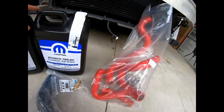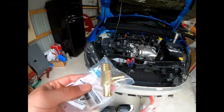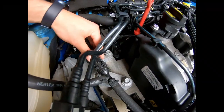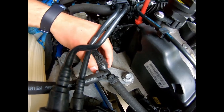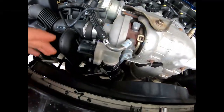For some of the parts, I have the coolant here, the radiator hoses that I'm going to be installing, and this little brass fitting — that's going to be an upgrade. It's going to go right off of this coolant tank down to where this tees, replacing the plastic one that tends to break on you.